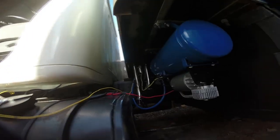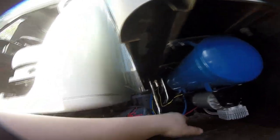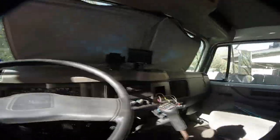Here's our final installation — I still need to clean up some of the wiring. Ground goes here and is grounded up to the chassis; 12 volt runs back down into the battery right here, fused right there. The tank reads about 100-120 psi. In the cab I decided not to run it to the standard horn — I ran it to my last auxiliary switch because I tested it out and it is incredibly loud, so I don't think it needs to be on all the time. We still have the factory horns as well.